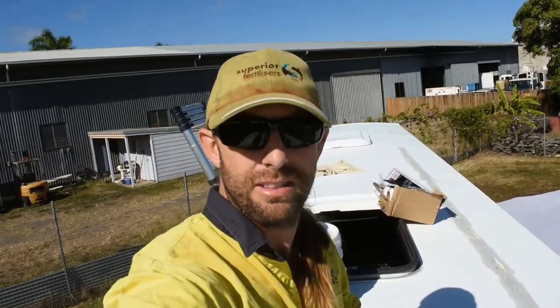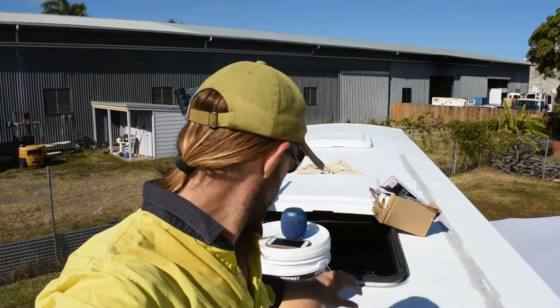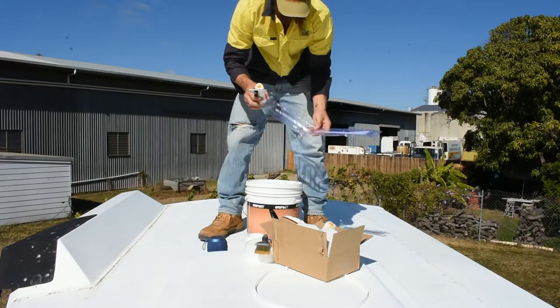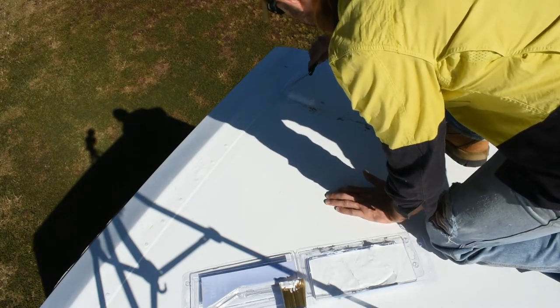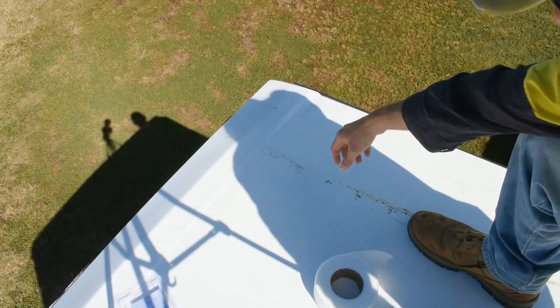I got the roof all gurneyed off. The roof needs to be completely dry before I apply the waterproofing membrane, so I waited until the next day to apply it in the heat of the day when it's nice and dry. Good morning everyone — it's another beautiful sunny warm day on the roof of the bus. The roof is dry now so I can start waterproofing. I've got some white waterproofing membrane, some reinforcing fabric, and a couple of paint brushes — that should be all I need.